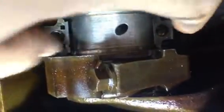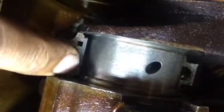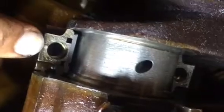Even if I put the piston right here with the other bearing, look — it's going to have that gap. See if I can get a real close picture. See how it's jumping right there on the corner? It's like a sidewalk — this is the road, and then it has a little sidewalk — but it's not supposed to be like that, it's supposed to be a whole road. Look at how much it ate. Amazing. I don't know if this little dip right here is supposed to be there, or if the bearing just ate and ate and ate.